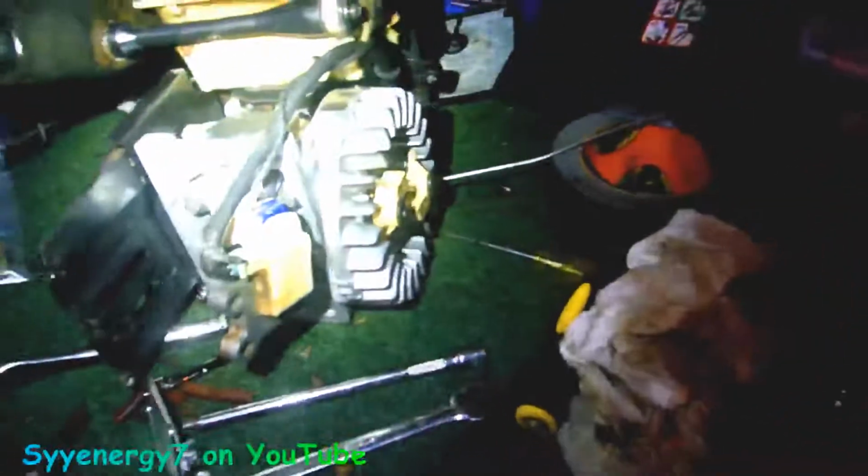Okay, I just cleaned off the saw. I'm probably just going to upload this right now because it's not going to be a big deal. This gap right here, when it's bolted to the oil tank, between this and that is 10 thousandths. That's where it's supposed to be. This has to be very chemically clean, which it already is. I want to wipe it down with a clean paper towel and some starting fluid. And also on this side, I'm going to use gray RTV to seal this all up on both sides, and I should be able to slide it in and bolt it down.